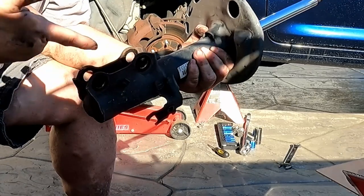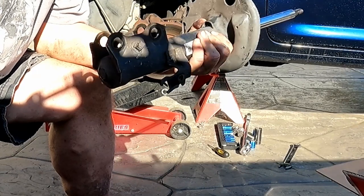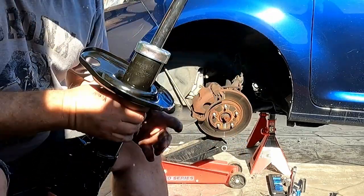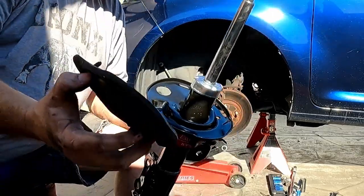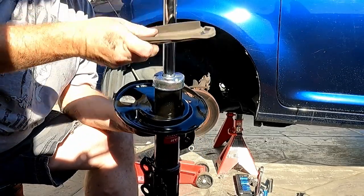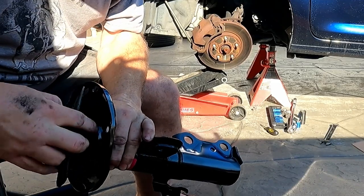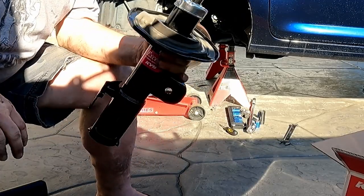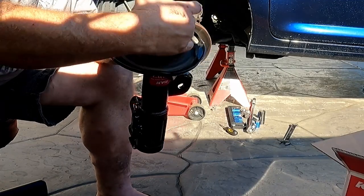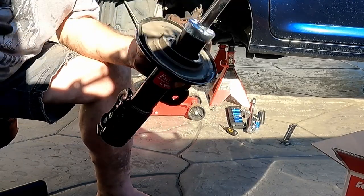So now we've got a bunch of parts — an old strut and a new strut. These are probably the original struts. Let's get all the parts swapped over and get ready to put it back in. First we want to take this lower spring seat — it's for our spring to sit in at the bottom. Kind of eliminates noise and gives it something solid to sit in. There's also a little tab that fits inside that hole. You could clean them up — just dust them off or wire brush them, whatever you want, get the dirt out. It might make it quieter.